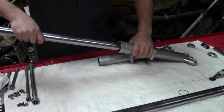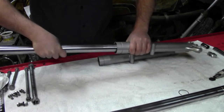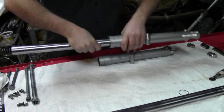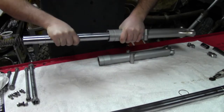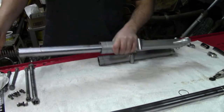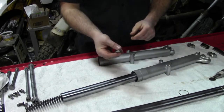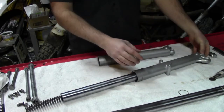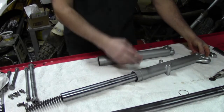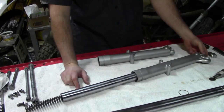When you're just doing it for the first time or one time, seal bullets are not really necessary. Just slide it together, maybe do a little twisting action, until it bottoms out. I have the spring in here because that'll push on the damper rod — as you remember, there's a little bolt that goes into the bottom of the leg, and that's what holds the damper rod and keeps the slider from coming out of the end of the fork leg.